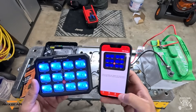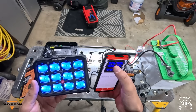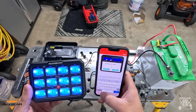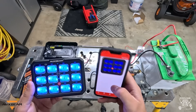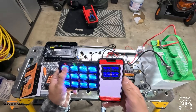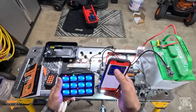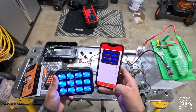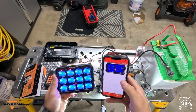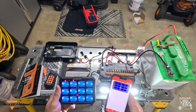The last thing I want to talk about is the group function. Say I want to edit my group and put one and two together — now that one and two are grouped, I'm going to save that. I'll call it G1 and hit save. Let me go back to the mode function and change that button to toggle so it's consistent. Now go back to group and see — when I press that, both of these come on. You can also see on the panel that both are lit up. That's going to work out great on my Jeep trailer because I can control them individually, but also group them together to turn them all on at the same time if need be.